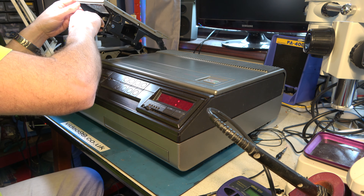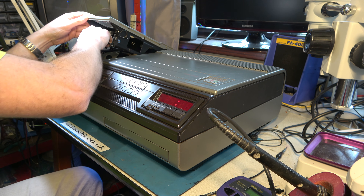What I'm going to do is just try a few of the basic things to get it running. If it starts taking a lot of time, I'll pause, take the head drum out and fit it into a known good working N1700 to test the heads, because I don't want to spend too much time on it if the heads turn out to be faulty. So anyway, let's get stuck in.